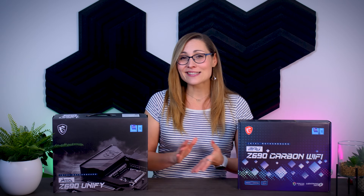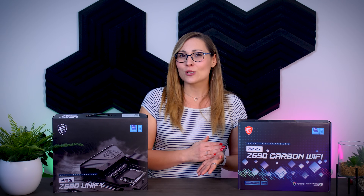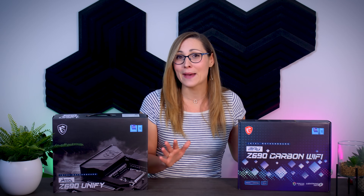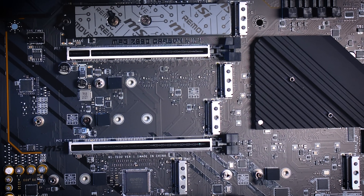The Gen 5 SSD discussion is a tricky one. Gen 5 SSDs don't really exist yet, and for many users even Gen 4 SSDs are barely worth the investment over Gen 3 models. That might change when Microsoft DirectStorage finally arrives, bringing real palpable benefits from very fast SSDs — but that's still in the future with no set release date. Also, Alder Lake CPUs only offer 16 Gen 5 lanes total, and typically all of those are dedicated to your GPU. If you use a Gen 5 SSD, it will use half those lanes, leaving only 8 lanes for your GPU and limiting its bandwidth.